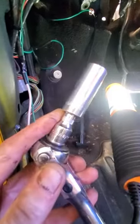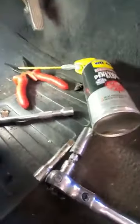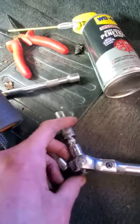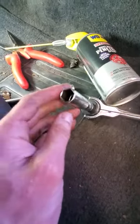You need a 9/16" socket to remove all four bolts. The hardest one to get to is the upper bolt. For that I used a 9/16" deep socket with a stubby extension — much shorter than a standard extension — along with a pivoting head ratchet. This makes life so much easier; with a standard solid head ratchet I'm not sure I could have gotten it out. You can use a large extension on the top furthest left-hand side bolt.